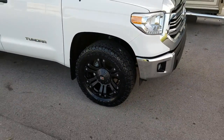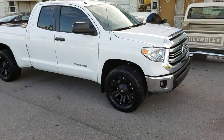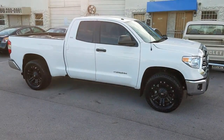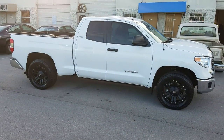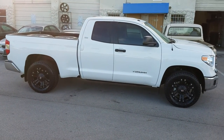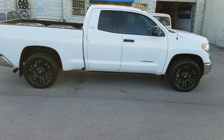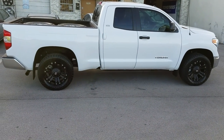You will have to take the Defender Flares off with a 305/50/20. It may still have some slight rubbing, but very very modest rubbing. But it looks good on the truck, so if you aren't really anal about rubbing and little stuff like that, then you can put the 305/50/20 on there with a 20x9 with no problem.